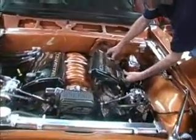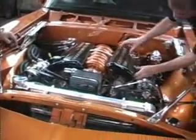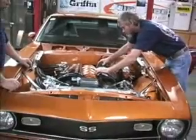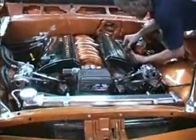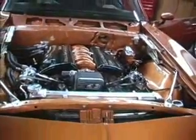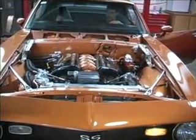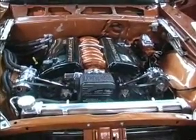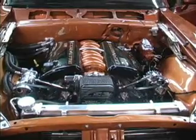We did smooth top covers, but Ken wanted the factory-look covers because we painted the intake the color of the car. Then we did the covers in black and came back and painted in the letters the color of the car, so this is really going to turn out to be a pretty car when it gets done. Let's see if it'll start up — you can hear the fuel pump come on. That's one thing when you do the 6-speeds: put a neutral safety switch behind the clutch, so you've got to have the clutch in for starting with 6-speeds. It's a good safety precaution and you can wire that right in through the ignition.